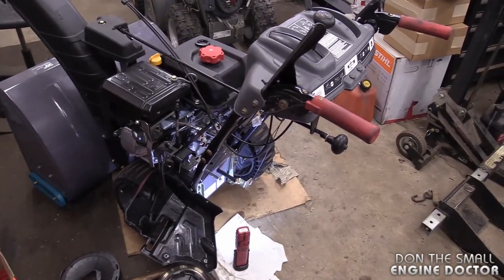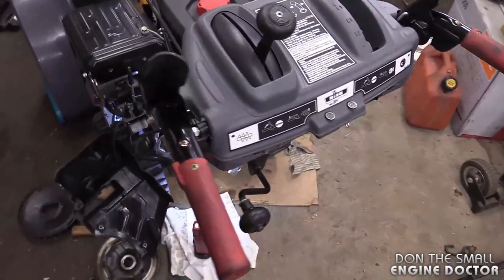If you've had a similar experience with these engines, please comment below and let us know where your snow blower was leaking oil and how you fixed it. One thing I want to mention: during the filming of this video, the customer hadn't told me that at some point his snow blower engine had backfired, and that since that day it was leaking oil like a sieve. I highly suspect that was the cause — the backfire may have sent pressure through the engine crankcase and basically popped the seal out.